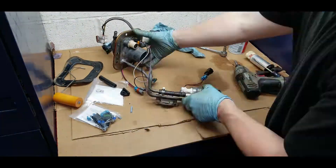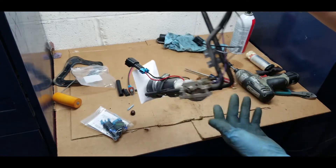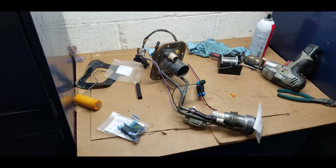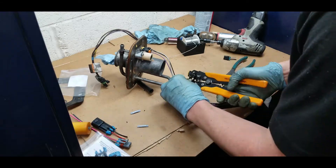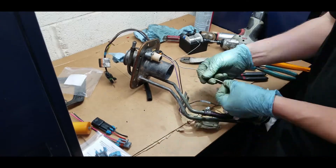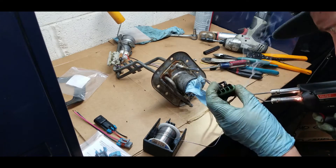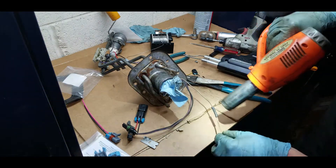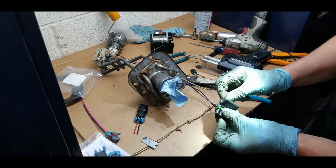Now we're going to wire up the pump. You could drill a new hole and run a rubber grommet, but that's kind of risky. The factory wiring is pretty heavy gauge even though it is somewhat thin — I don't think it'll be a problem providing enough amps to this pump. If I were to go to dual pumps, I'd probably put a bulkhead fitting through the top so it wouldn't pinch the wires. I don't like using heat shrink in there because you never know how it's going to hold up to the ethanol content, so what I end up using is just the supplied bite butt splice connections. Those are pretty much set up to handle the fuel. You definitely want to stagger your connections so if one of those sleeves on the butt splice connectors comes loose, you're not going to have any arcing inside the tank.